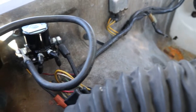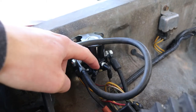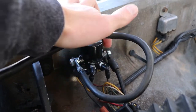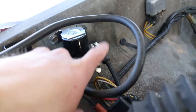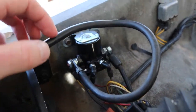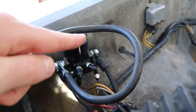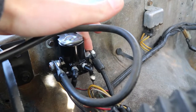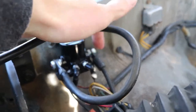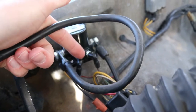I will show you what a solenoid looks like that's hooked up correctly. This right here is what the solenoid normally looks like. You've got your grounds, hot from your battery — the ground from the battery goes down and usually grounds on the block of the motor. You have positive, your start side and your ignition side, and this goes to your starter down there. You want to make sure the wire going to your starter is not corroded and contacting the body — if it is corroded, when you go to start the truck the starter will just stay engaged.